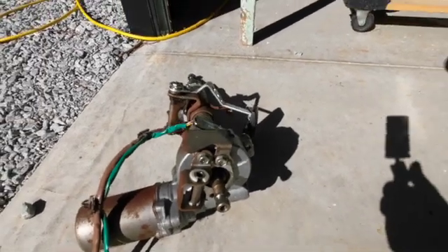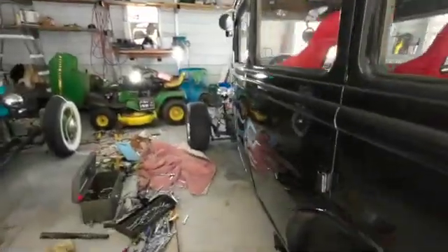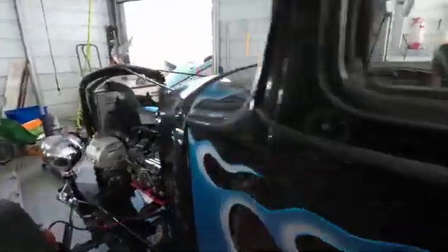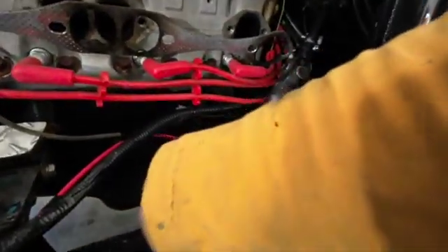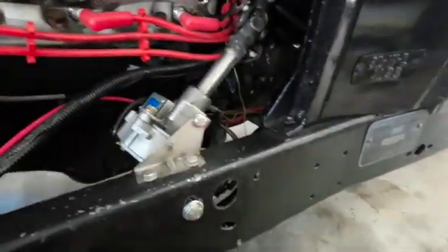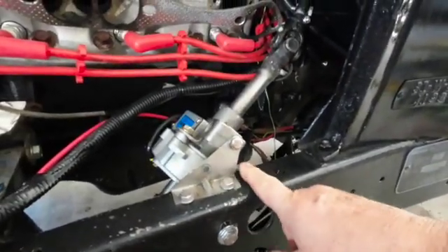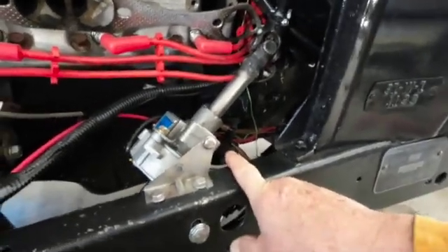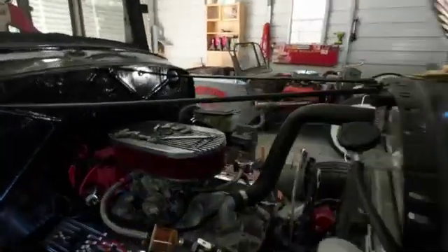Other than that, it's pretty easy. I wound up with three wires. I ran one up to the positive side on the back of my alternator — that's this wire here, disconnected now because I'm working on the headers. I grounded the other wire back to the unit itself, since it's grounded to the frame — I have a brace up here and one under here that attaches to the frame. And then there's one more small wire that needs to be hot when the switch is on; I ran that to the choke wire, which is hot when the switch is on.